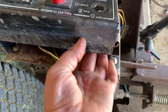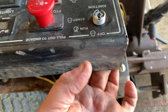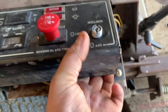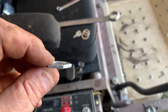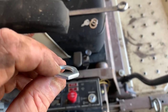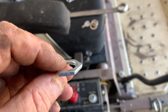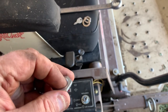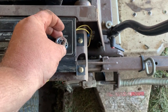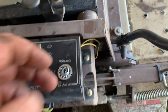Snake it back up underneath and poke your switch back up through the hole just like that. Install your lock washer and install your new nut. Now these nuts are just punched out of a piece of metal — if you look, they're kind of concave a little bit. There's a flat spot and then this side is kind of rolled. Always put the hump or the rolled part out — it just makes it easier to start the threads.